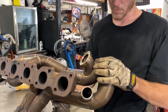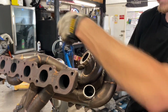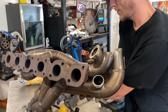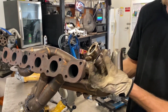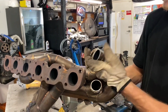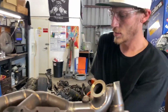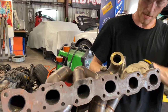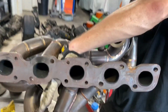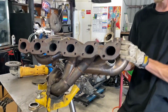And plus both wastegates are going to be basically top and bottom, right? Yeah, they'll be right here and right here. That's perfect. I know that before it just did not make much sense. It had this piece on there, so it had 3 or 4 welds and one within 2 inches. So I chopped all that out because it was interfering with the valve cover already. That's going to look a lot cleaner too, a lot nicer. The one wastegate will dump down behind the AC condenser, and then this one will dump through here down by the downpipe. Sweet. Be cool.